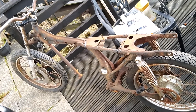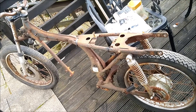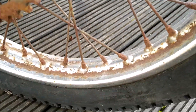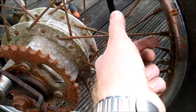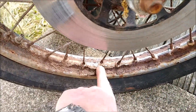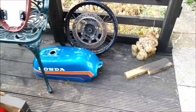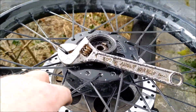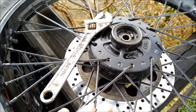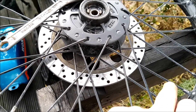Today I'm biting off a bit more than I normally would. This is an old CB100N I've got with various bits and bobs. The wheels are pretty rusty and I wouldn't trust the spokes anymore - the front end is probably even worse, it's pretty chronic. My plan is to use a SimWolf front fork with a disc brake front end, and take this hub for the front end and fit it.